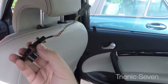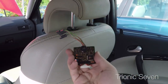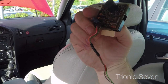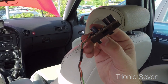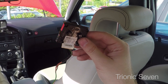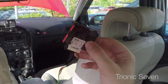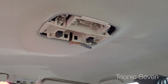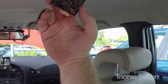Just a quick word about the sensor - it's a different model for the four-door and the five-door. The four-door has one long connector, and the five-door has two connectors, one of which goes to the back of the vehicle to the trunk. Also depending on the type of seat you have, you need a different sensor. This one says 'läder' in Swedish which means leather, and you need a different type of sensor if you have textile or textile with leather inlays. If someone breaks the windows in a leather seat car, the reflection of the sound is much more intense than in a textile car, so it needs a less sensitive sensor otherwise it might trigger on its own.